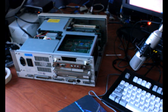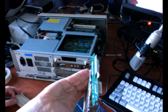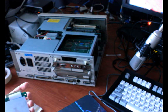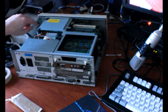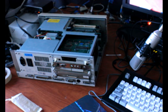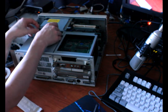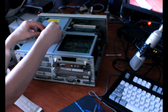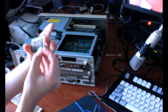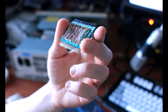But yeah, so these things are a little funky. They have a ribbon cable on the back that breaks them out from this laptop style connector to a 5.25-inch connector style. And so the brackets need some spacing that isn't provided by most 34-pin IDC to card edge adapters that I found. So I had to make my own spacers. And those look a little funny. Yeah, I would recommend not doing it like I did it.